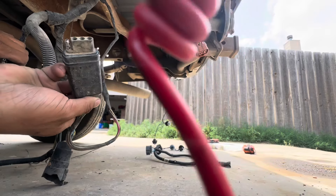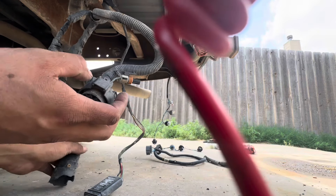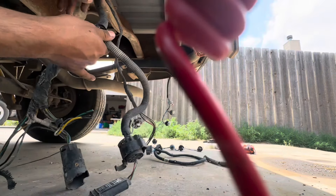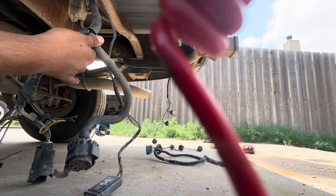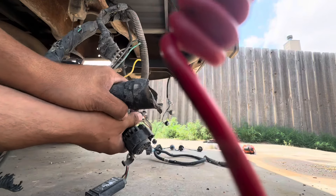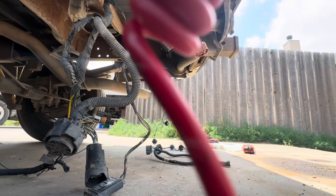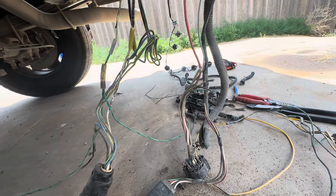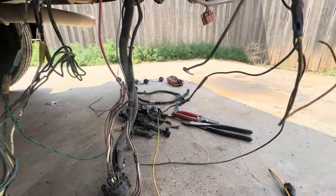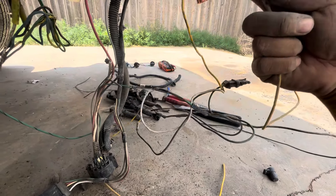I didn't hit record but here's what we have so far. These two are right turn signal and tail light, but they only work if you have this hooked up — which I believe comes from the truck and is the camper setup. Unplugged, this is dead, this is dead, and the rest of it's dead. So now I need to take this all apart and figure out why they have a duplicate, because this goes to the hitch and isn't long enough to reach the bed for a gooseneck.